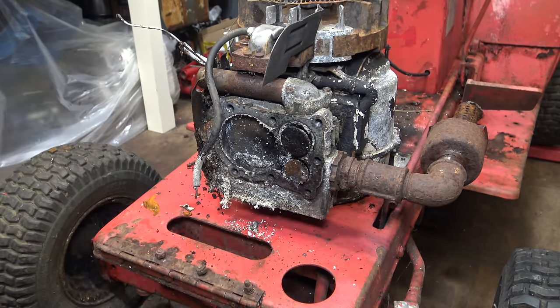The reason why is because this is actually made out of aluminium, and what we see in here is rust, iron oxide. So that must have come from the intake tube. So maybe the carburetor itself isn't that bad at all. Maybe it just needs to have a really good clean. So what I'm going to do is probably blow it through with the airline, put a bit of carb spray through, and then put it into the ultrasonic cleaner for a few years might do it. No, probably about 40 minutes, 30 minutes.